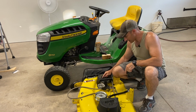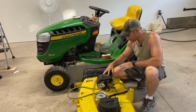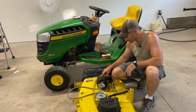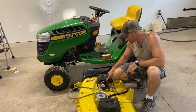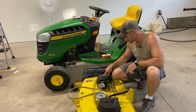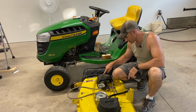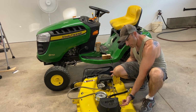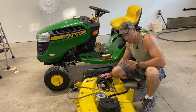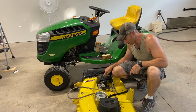All right, now that I got my blade brake changed out, make sure whatever you're doing to take your deck off for, you check your brakes. If they need changed out, watch that video. If you haven't checked your bearings on your blade spindles, check that video out. Both the bearings in this one and in this one were sealed on mine. So every time I greased my bearings, it probably really wasn't greasing my bearings. Now that I unsealed them, the grease is going to go to my bearings. Well, now I'm going to show you how I put my deck back on.